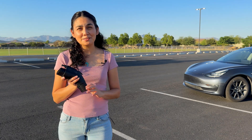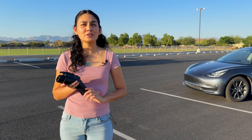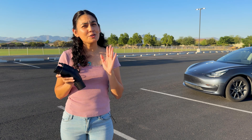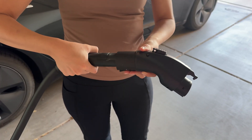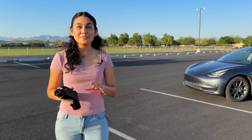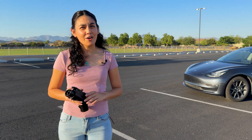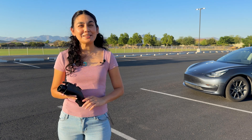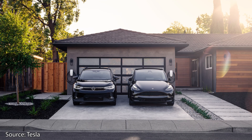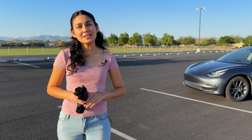This adapter is the exact opposite of the previous, converting a Tesla connection into a J1772 connection. It's a third-party adapter which I use to charge non-Tesla electric vehicles on level 2 Tesla chargers. This adapter and others like it are not designed for fast charging, so they won't work at Superchargers. When I have cars to review, I can charge them up on my Tesla wall charger at home — makes my charging convenient and cheap. Speaking of third-party adapters, if you're ever in the market for one, be careful what you buy. There are a lot of third-party adapters that aren't safe and can cause damage to your car or charger. Always look to see if your vehicle manufacturer sells one, or look for a trusted and verified alternative. If your household owns a Tesla and one from another brand, you can always get the Tesla universal wall connector, which has one of these adapters built in, so you can charge any EV off of it.